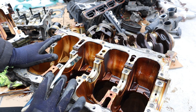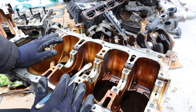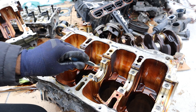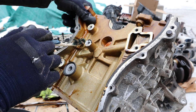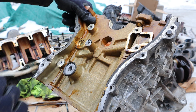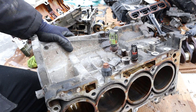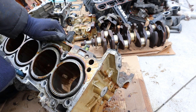Taking a look at the block, the design is actually very similar to the Hyundai Theta engines I've taken apart before, although this one is not nearly as problematic due to manufacturing issues. The oil from the upper oil pan is sent down through here and into the central gallery that runs along the length of the block. The main bearings are drilled and tapped to lubricate the crankshaft and connecting rod bearings. There is also a tap to feed the hydraulic tensioner for the timing chain that goes to the camshaft. On the side of the engine we've got a coolant temperature sensor and two knock sensors for pre-detonation. This hole lines up with where oil goes into the head for lubrication.